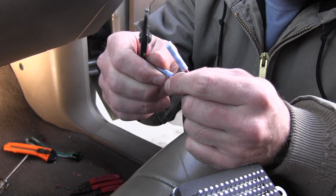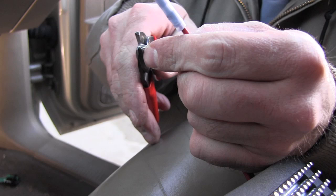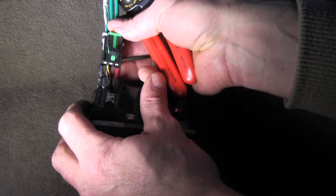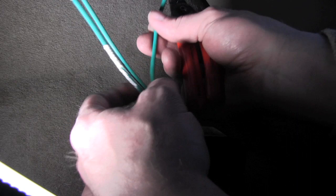That was just a little longer than I'd like — see how it doesn't quite go all the way in? We're going to take our little wire nippers and just nip off a little bit of extra wire, and that'll put that plastic insulation right up inside there — it's a beautiful thing. The easiest way is to set your plug like this — see there's a little nipple on it. We're going to start with the red wire and go straight to that one.